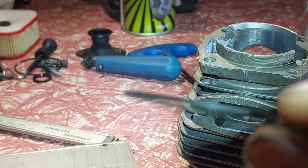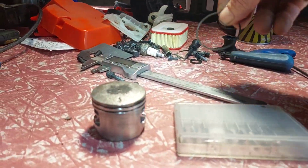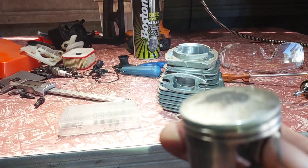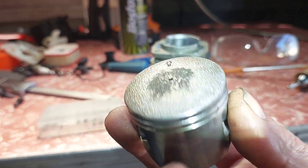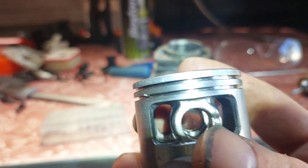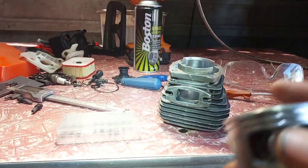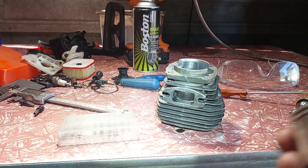The ring on this piston is really thin — probably about 1.2mm or so, thinner than the other one. Just things to pay attention to when working out your parts. These are the 52cc source pistons at 45mm bore — this one is 45.2mm, so not much difference. But you won't get this into a 52cc, and even if you did the pin would be in the wrong spot and your stroke changes. Alright, that'll be the end of this — I'll clean it up, get it on, and the next video will show it running.